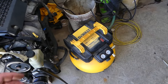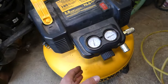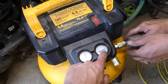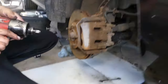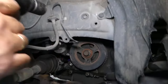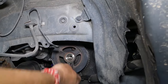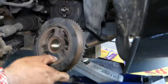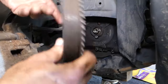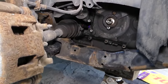Now we need to remove the crankshaft pulley. We're using a DeWalt air compressor set to 165 PSI with an impact and a 21mm socket (13/16 also works). Once the engine is at TDC, go ahead and remove the bolt - it came out with ease, though sometimes you may need to hammer with the impact a few times and wait for the compressor to reload. Remember: this is not a keyed pulley, so installation position is critical - otherwise the crankshaft position sensor will read incorrectly and your car won't fire.